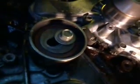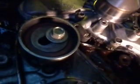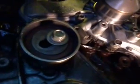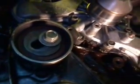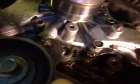We just took the belt off. The way you do that is you first loosen that screw on the timing belt tensioner, it's a dynamic tensioner, and then push it enough to the side to release the pressure, and then just slide the belt off. Once the belt's off, you can actually slide this back the other way and take the spring off the tensioner. It's a spring that goes between here and there. You can see a little nub sticking out, but that's where the spring goes. And that just holds the tension on the belt. See what I mean? And we're going to actually replace this tensioner because it is older.